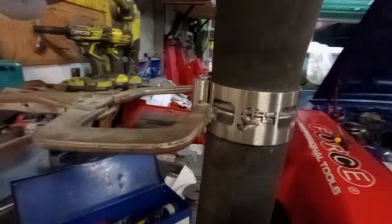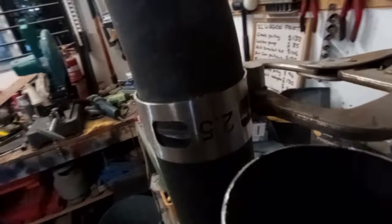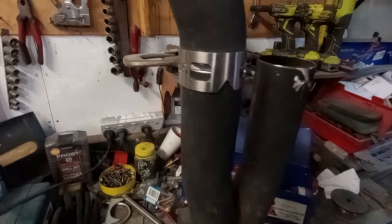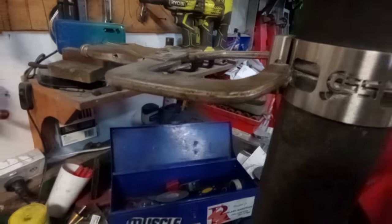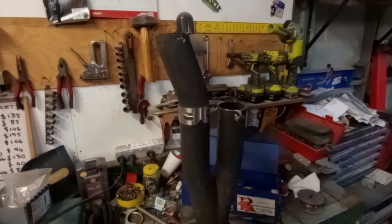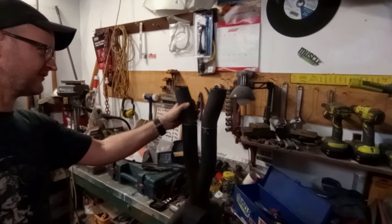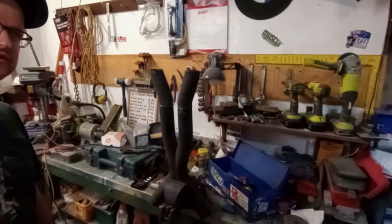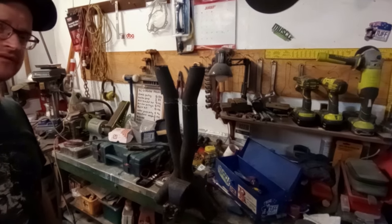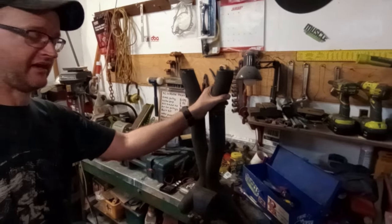There is the tacking band in place. Note how easy it's going to be to get to those joins to throw some tacks on. Really, I need to tack these in 2 places at this point, just so I can locate these pipes for some experimenting. Just like that, my 2 chopped off segments are re-welded at an angle that is more conducive to this project. Tidy up these ends though. Bad.